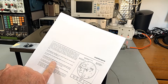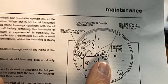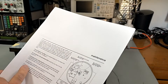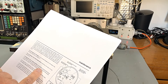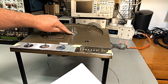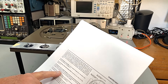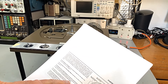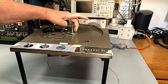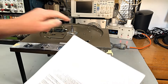And the bearings on the turntable spindle. This is the elusive screw that's in there. I lubricate it by saturating the felt pad around the spindle, which we have done. And by removing the screw from the top of the housing to apply a few drops of oil through the hole which is then revealed. We haven't done that, so there will be no oil in the centre of that - so we will do that.